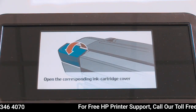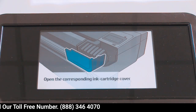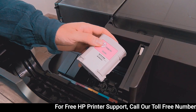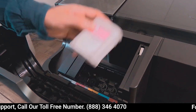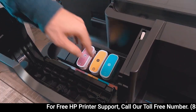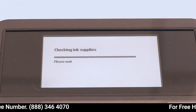Open both the left-hand and right-hand side ink cartridge covers. If your printer is a Z6, you will only use the right-hand side ink cartridge cover. When prompted by the front panel, insert the ink cartridges one by one. Each cartridge is marked with its own color and should be inserted only into the slot of the same color — avoid touching pins, leads, or circuits. The ink outlet in the cartridge should meet the ink inlet in the slot; push the cartridge in until it clicks into place. Close the ink cartridge cover and repeat for the right side. The printer now prepares the ink system.